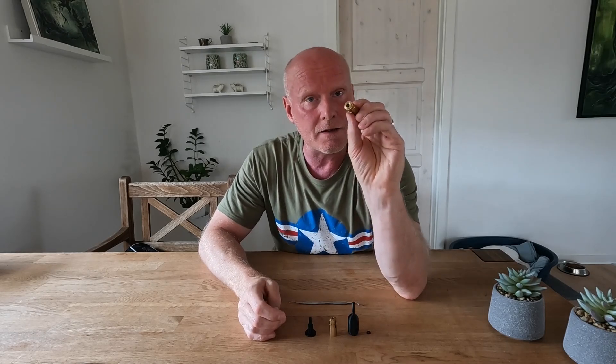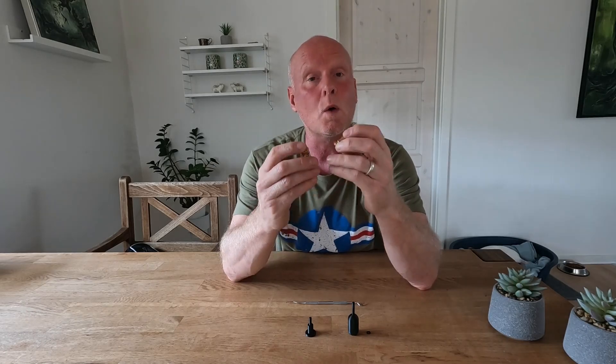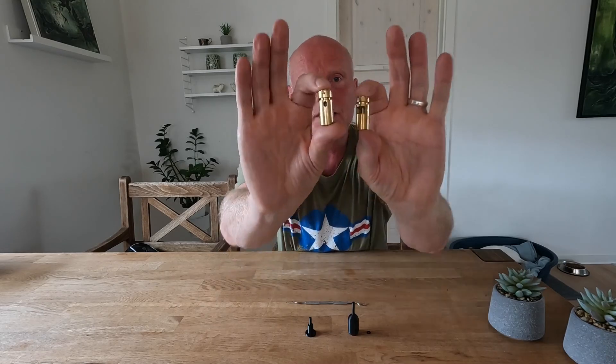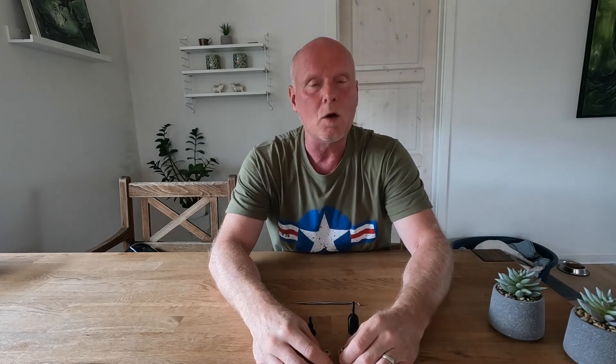One thing I do need to mention is that the groove inside the transfer port is not placed in the exact same spot on all kinds of transfer ports. As you can see here, these are two different transfer ports and the groove is placed in different places. You can design it to whichever transfer port you're using so it fits exactly, or you can just adjust by lifting up the transfer port slightly after installation.